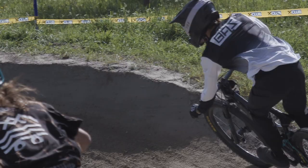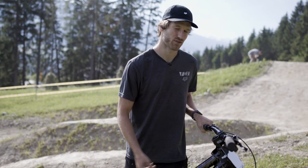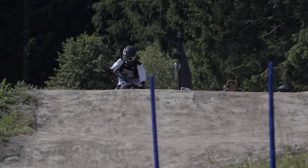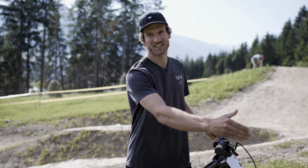but fully opened up, so it's like a nice progressive platform to push off of. I think 120 psi in the fork — you're not bottoming out anywhere, carrying good speed. I think that's pretty key for slalom. Little things that I like to do: I set my brakes up at 37 degrees using my phone measurement app so that they're always the same. And that's my bike.